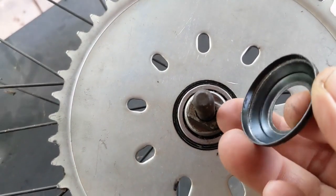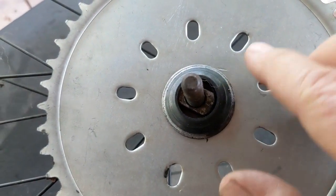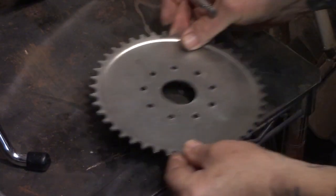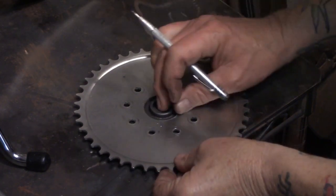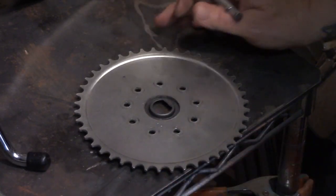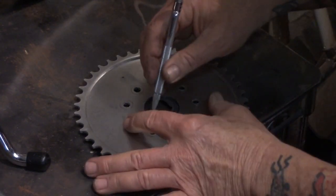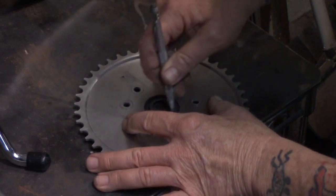See that little lip on it - we're going to need to trim that lip off so it fits inside the hole in the sprocket. Here is how I choose to do it. You can throw the dust cap away, or you can drill the hole bigger in the sprocket - reason why I don't drill the hole is I've got to make sure I get it centered, and for me it seems easier to just trim this thinner piece of metal than to grind or drill a centered hole in the sprocket.